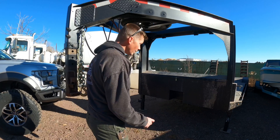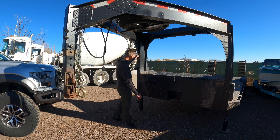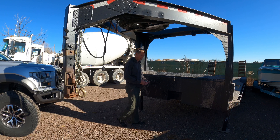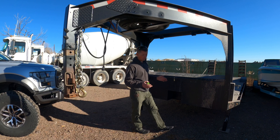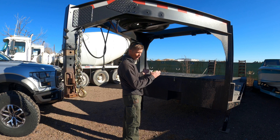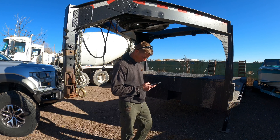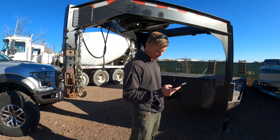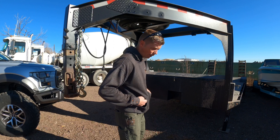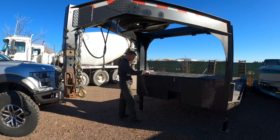Trailer width on the neck here is 100 inches, based off of the frame rail width. These uprights for the gooseneck are welded straight through the frame rails, and that width is determined essentially by the axles — the axle width and the widest frame mounting points. The trailer is 102 inches wide. The axle is 95 inch hub face, 80 inch spring centers — that's exactly what I used to determine the width of the frame, and that's what determines these uprights as well.